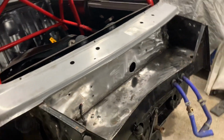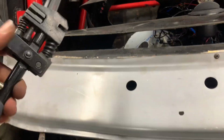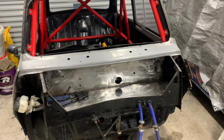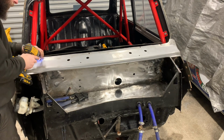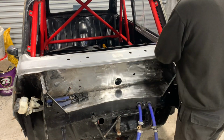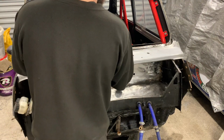Right, so now I've got a jiggery pokey, I call it. Because it jiggeries on the one side and it pokes holes on the other. So, basically, I take the panel back out and put this. Oh dear. All the way across. But what we'll do first, we'll take the panel off and then we're going to drop some primer all across here. If you don't want to bleed bare metal under the panel, there we go. If it needs, yeah.